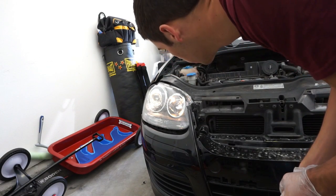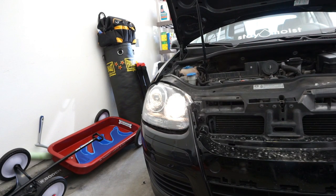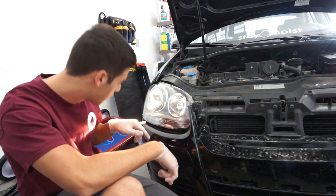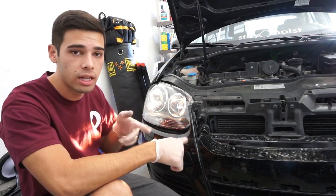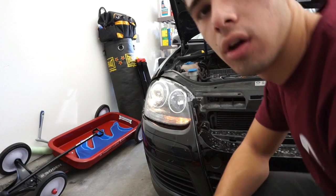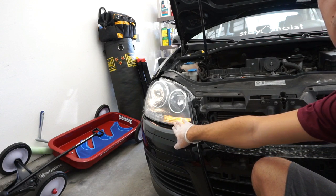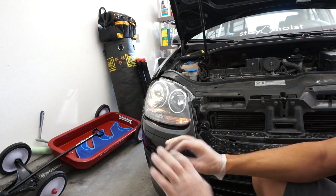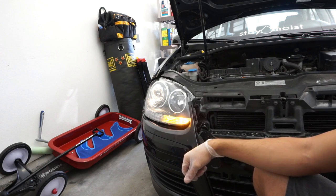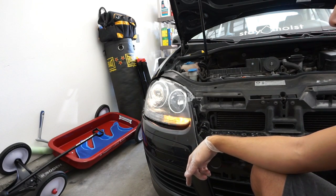The lights work. I'm going to put on the high beams — those seem to work pretty well too. I'm getting a headlight sensor on my dash, and I have the right blinker on right now and it's not working. I'm going to take it out and switch out the blinker. The blinker's now working — it wasn't the bulb, it was just the way the bulb was in there. It just wasn't making a good enough connection. So I switched that and I think it's good to go.